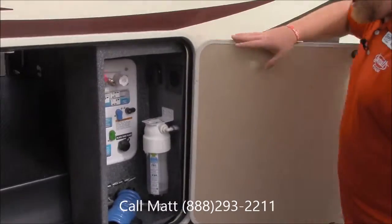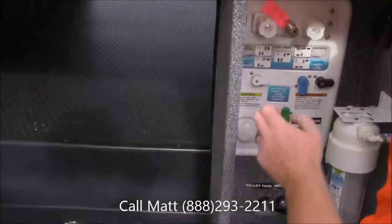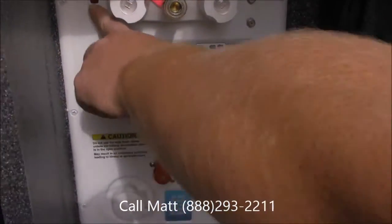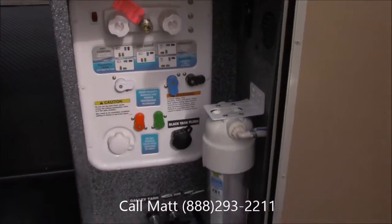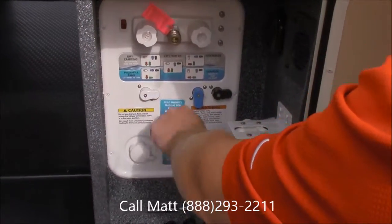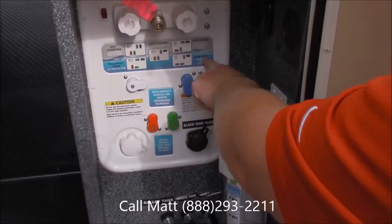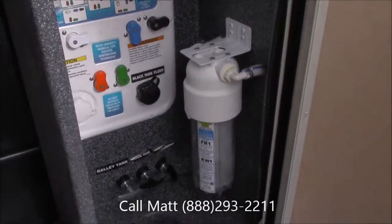Here in your convenience center you've got of course an outside shower — it's a quick connect that goes right there. One of the nice things they did here too is they put a water pump switch out here so when you're winterizing you don't have to go inside to flip your pump on. You've got all your switches right here and a diagram that tells you how to make everything work for sanitizing, winterizing, city water, filling your tank, dry camping, however you need to do it.